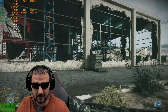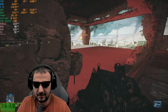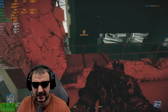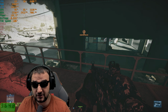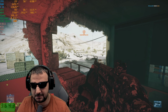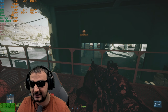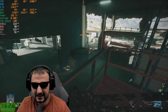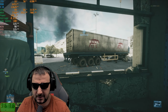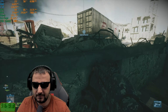I want to see how it's performing like this. I'm not gonna lie, because I want to see if it's protecting the video card. Maybe I should put a limit on the video card and see how it's underclocking. This is a good scenario in which the video card can actually exist, you know, when the thermal paste is bad and you don't know it. How does it behave? Does it go down on the clock? Look at that, 1.5 on the clock in order to maintain it with 86 degrees. That's a bad thing, seriously. But yeah, I can't say nothing bad about it because it does the job here. It's maintaining. Even turn on the ambient here in order to get better temps.